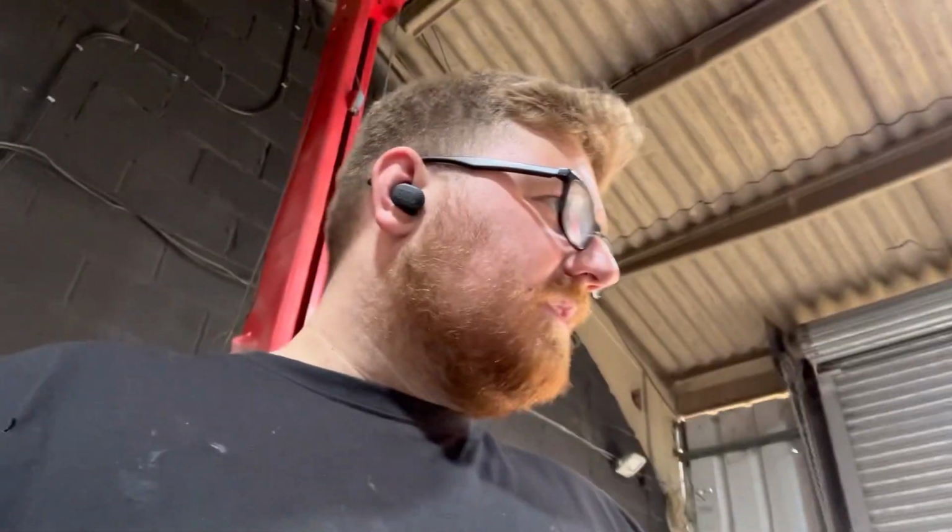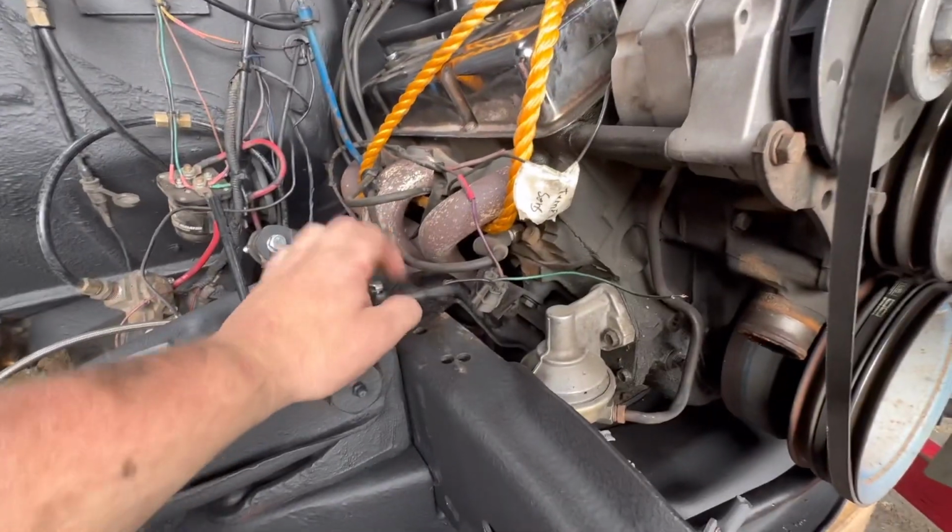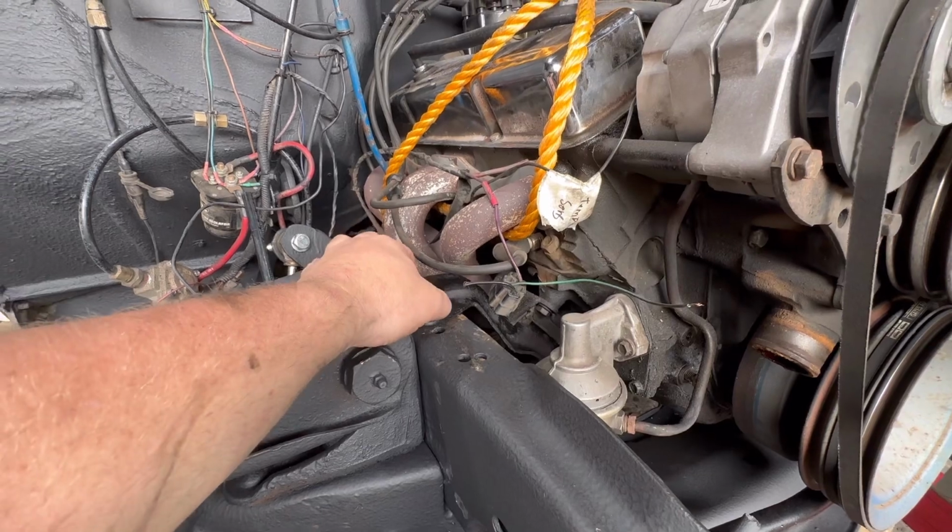It's in, so that took me over an hour to get it into the position that it's in now. It actually took so long on my own. Perks of working on my own, I guess, but I can show you what the first initial problem is, which can be resolved quite easily. The link bar for the steering, if I can actually get that on picture, it's touching the front pulley. I just need to raise the engine up 30 mil and that will probably do it just fine.